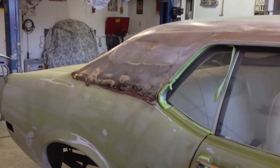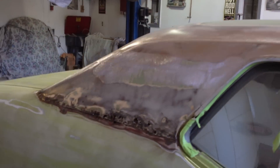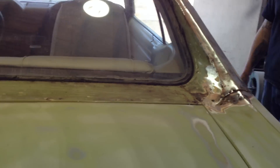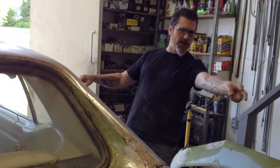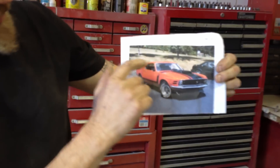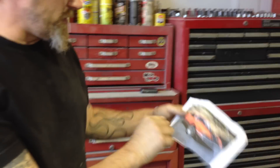The good news is I actually had the owner over here today and I talked him into putting a vinyl top back on it. It doesn't mean we're going to do a hack and whack - we're going to cut it out properly and fix what's going on in there for rust. But with the vinyl top going back on, we don't have to get too perfect with the bodywork, because if you're painting this car without the vinyl top you'd need it pretty straight, and there's a ton of work needed here. So he's going with the vinyl top - that's going to solve a lot of problems. The orange body, gloss black rims, a black vinyl top, black behind the tail lights, hood scoop, stripes - it's going to look really sharp.